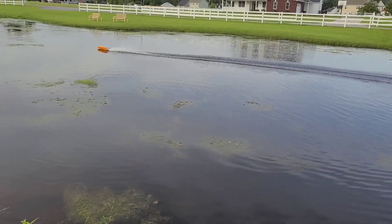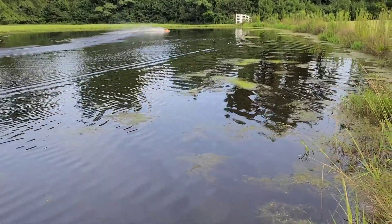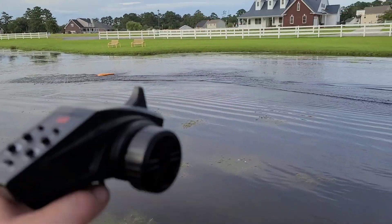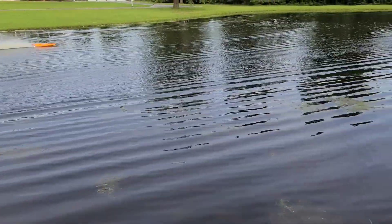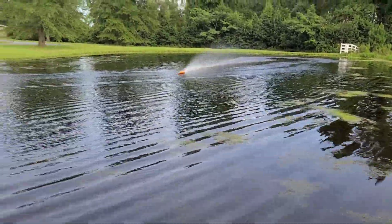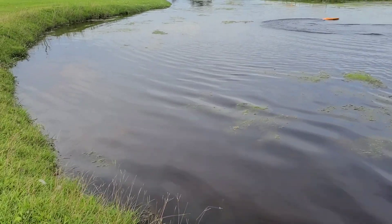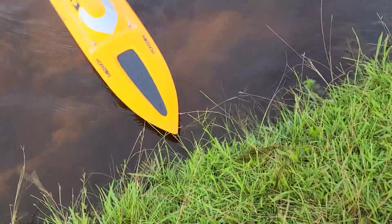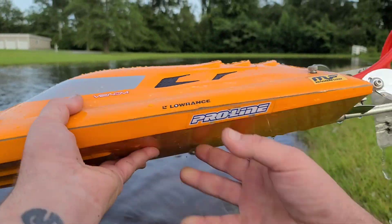See how wet she's running — pay attention to the spray off the back and the sides of the boat. See how stable the boat is, set into the water when it's running. It's called running wet. The boat actually looks like it's running good, but it's too wet if you're trying for speed. You want the boat to run kind of dry, up out of the water. You use your trim tabs in conjunction with your strut and you can basically make your boat do anything you want.